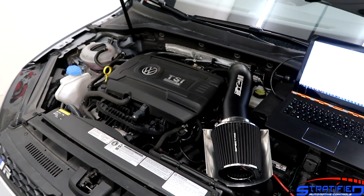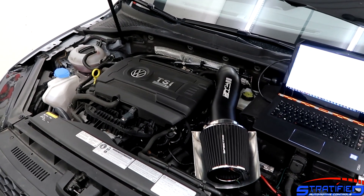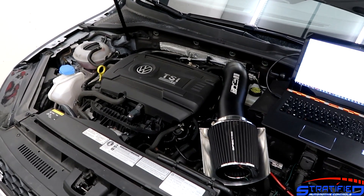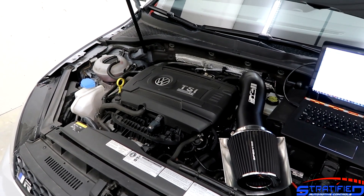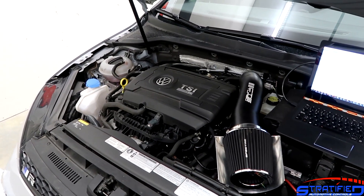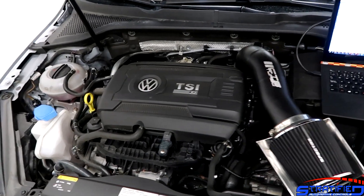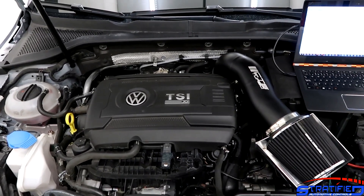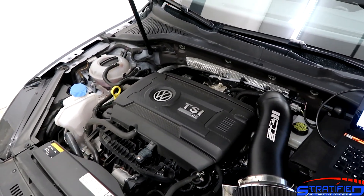In terms of results, let's talk a little bit about fuel. We used a mixture of ethanol and pump gas. Here in BC we have very poor octane — even our 94 octane is actually very poor fuel, and the reason for that is because there's no ethanol content in it at all; it's been legislated out. Because of that, this customer added some E85 and we ended up with a blend just below E20 — E17 is what's in the car.